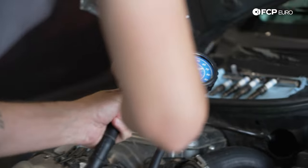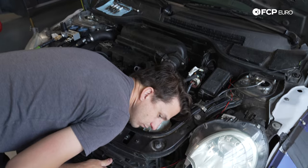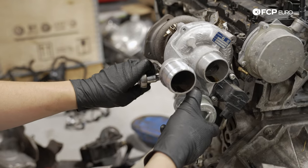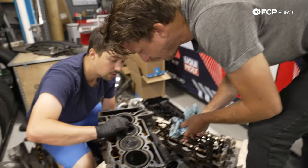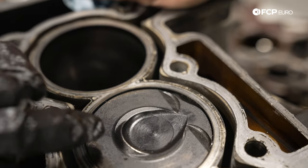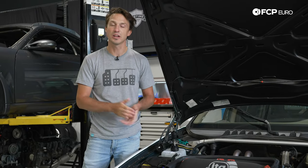With the results of our diagnosis — as much as we hoped for a simple head gasket job — zero compression on cylinder number two was alarming. Even with a really blown head gasket you would expect to see around 10 psi. Upon further inspection, we found oil in both ends of the turbo and intake system, all of which were riddled with a little bit of metal flake. The call was made to pull the engine entirely and take things apart. What we found was quite the smoking gun: the cylinder number two piston was melted completely into the ring lands, which justifies the zero compression. This likely happened from localized overheating of that cylinder, most likely due to a clogged injector, a bent valve, or a failing head gasket.